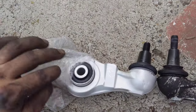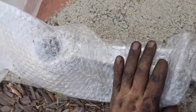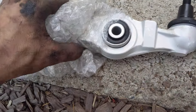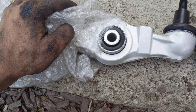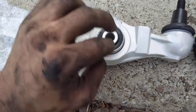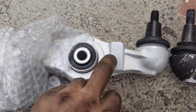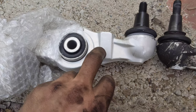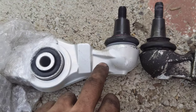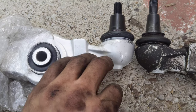Working on the suspension on a 2005 Passat GLS TDI. I bought a pack of these suspension arms on eBay — it seemed to include everything for the 2005, I'll leave a link. Honestly, the aluminum didn't seem too bad of quality. I used a spring-loaded center punch and punched my arm and the new arms, and they sunk in about the same. So the aluminum seems fine.